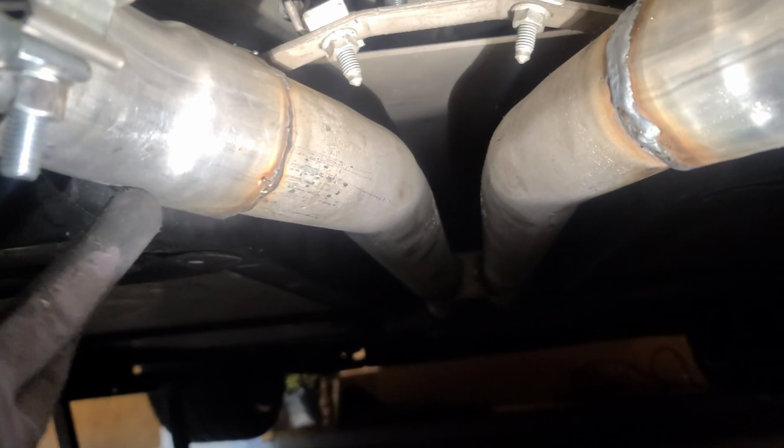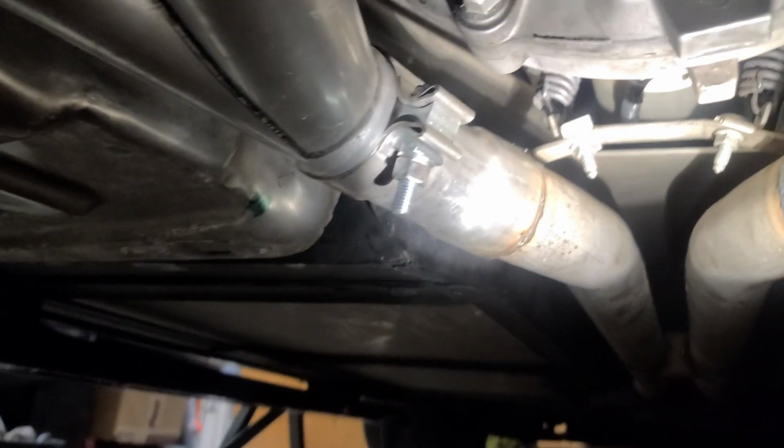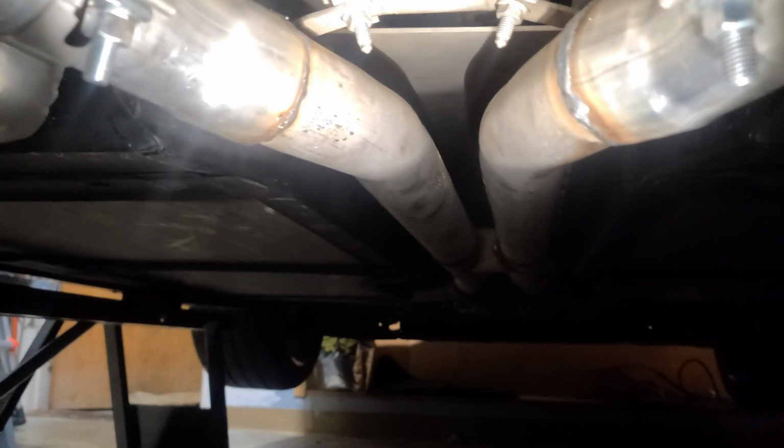Alright, I'm back from the muffler shop. Got these two pipes welded. You can cut it like how I said, right here. Cut it pretty far, but you can cut it right here where this flange is. They slipped it on, and then angled it so it could fit straight, proper. Nothing's hitting now. It clears pretty well. Got barely enough clearance right here, and then this side's not hitting at all.